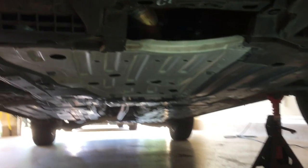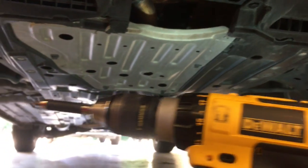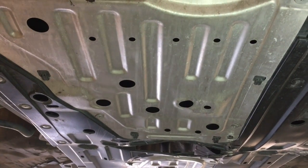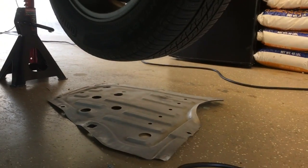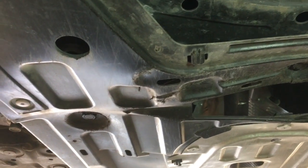We let the back down and jacked the front up. The first thing we've got to do is remove this metal cover. I use a cordless drill with a Phillips bit in it. It's got four screws. I've removed the metal pan — that's all you need to take off when you change the oil. But we still can't quite get to where we need to. There's the low pressure fuel filter housing right there. We probably need to take the rest of this plastic off using a flat-bladed screwdriver and a 10mm socket.